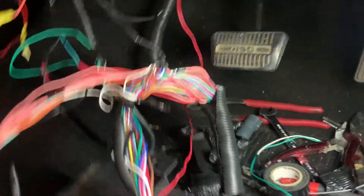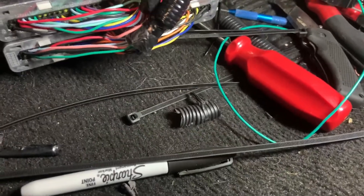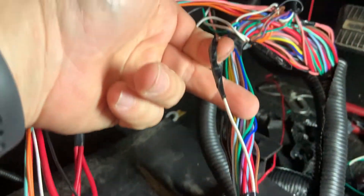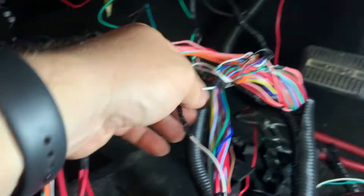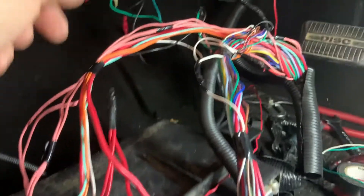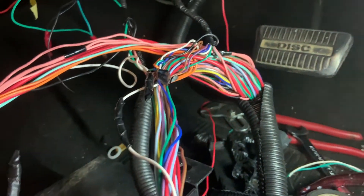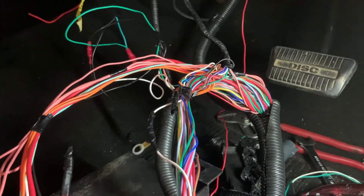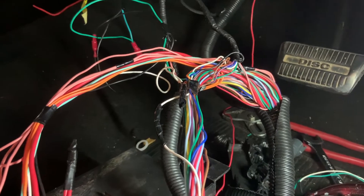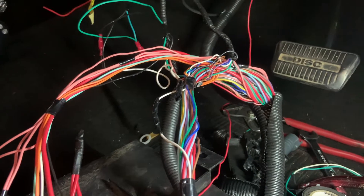In amongst the power wires, the wire coming out of my ECU was correct. It's coming out of pin 10 on the red plug, going up to my dash — comes straight up there, just loosely bridged together at the moment while I'm playing with it. But what I found when I started pulling the harness apart was the power source for the OBD was actually all connected together. For some reason they've given a permanent 12-volt supply directly to pin 10 on my ECU and my tacho.